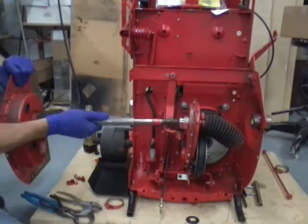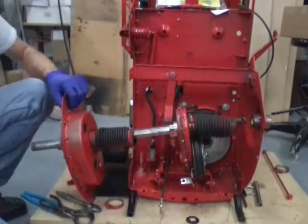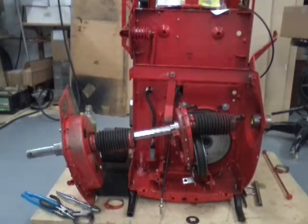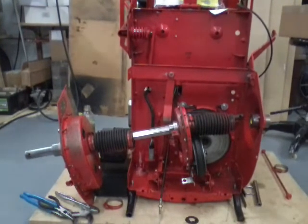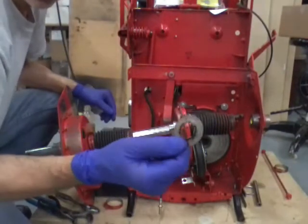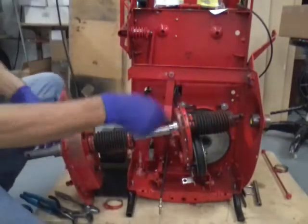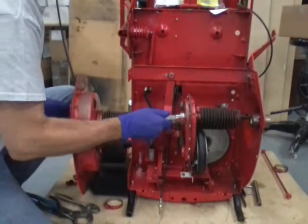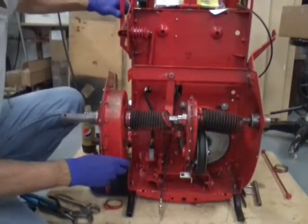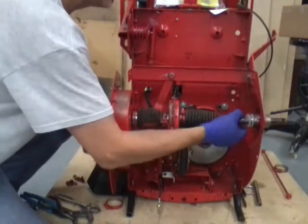This is probably going to be a three-person job. Before you get that all the way through, we're going to grab two shims because I'm pretty sure I'm going to need them. First, slide on that thrust washer with the hexagon teeth sticking out, put two shims on, and insert the axle in that bushing. As the hex shaft appears, we might need to shift into a higher gear and pull it over some more. We want to make sure that snaps in the way it's supposed to.